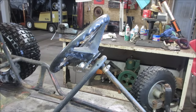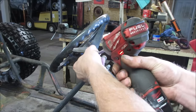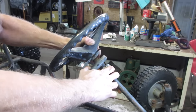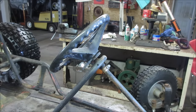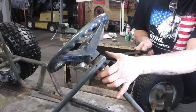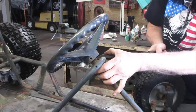Putting the wrong tool in the wrong hole. You would think it would just kind of put a nut and bolt through it. I think the chances are that's just going to fall right off of there. Yeah, I didn't think so. Let's get something to try to pry underneath it and or beat it into submission. My guess is the metal collar under there and the wheel are going to weld themselves together, which kind of sucks because you can't put heat on that because you're just going to melt the wheel. Let's see if I can come up with a puller.